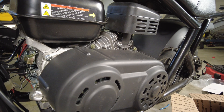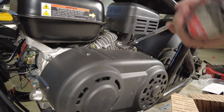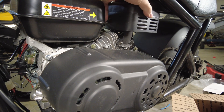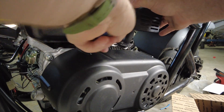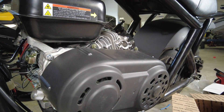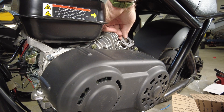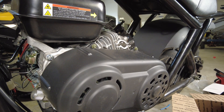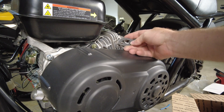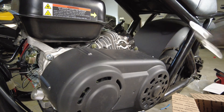I'd like to get something with decent performance but still some muffling. Let's rip this off and put the straight pipe on — at the very least we'll hear what it sounds like. The muffler doesn't want to come out over the studs, but a small pry bar does the trick. The exhaust gasket doesn't seem to be in bad condition. As I said in my first video on the 224, the spacing of the exhaust studs is a little further apart than on the 212, so the 212 exhaust won't fit directly, but a little touch-up with a file should be all that's necessary.